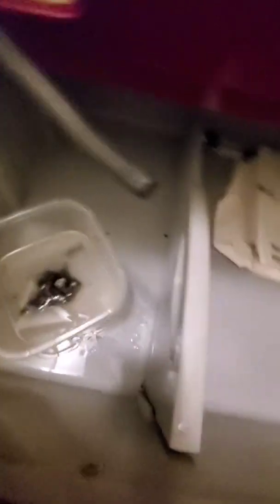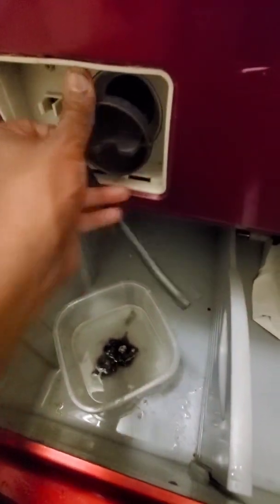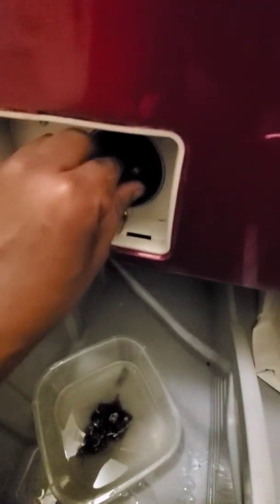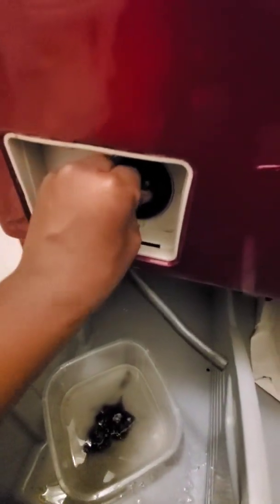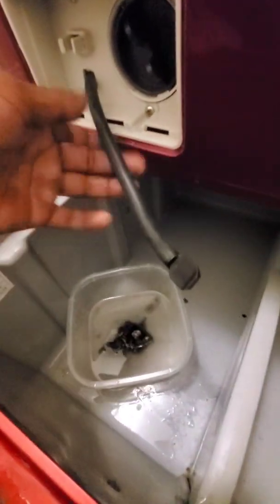How I like to do it is I like to turn it — there's a lot of stuff in here. Once you get that all cleaned up, take that and put that back in there. Turn it counterclockwise until you hear a click or a slip, just like that. And then turn it clockwise until it fits. If you don't do this before you screw that in, you're gonna fill this washer up with water and this is just gonna leak — water's just gonna pour out continuously. Install that cap back in there, push that back in there, and hey, you are good to go.